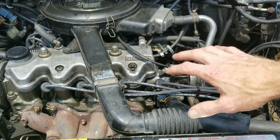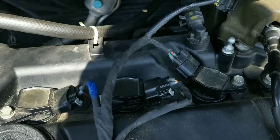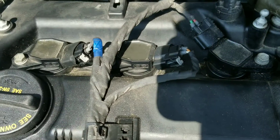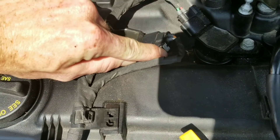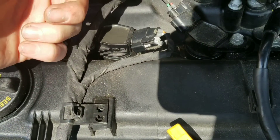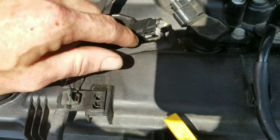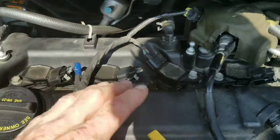Like I said, for coil packs it's the same way. Just unplug the clip — with the coil pack's clip in, for example these clips — you want to just pop these clips off and pop that off right there during the test. It's as simple as that. Pull this out; first you've got to pop your little clip out. I always use a screwdriver to push in right here so it's loose and I have it out like that when I'm performing the test. Have all these out for each one because that's what holds them on tight. Then once you start your vehicle up, come back and just pull this guy right off, each individual one, one at a time. I want to thank you guys for watching with Nate's Interactive Auto — you guys keep on wrenching.